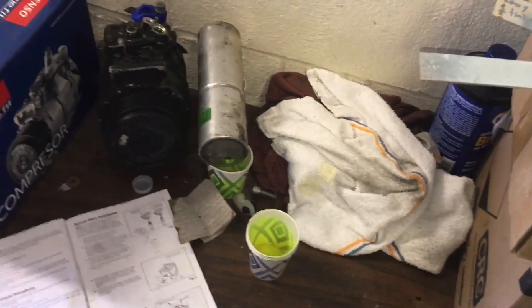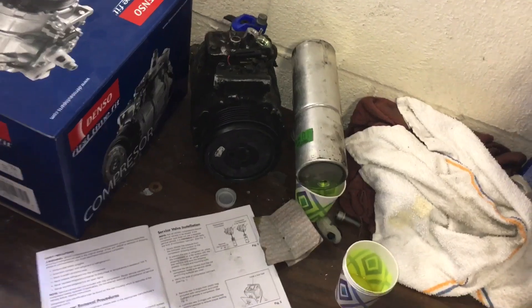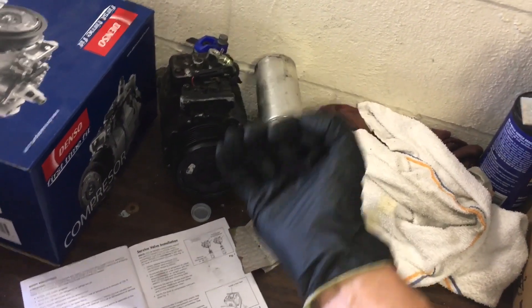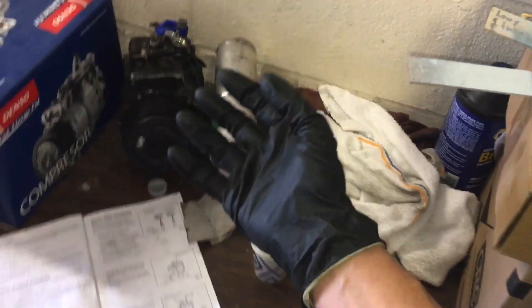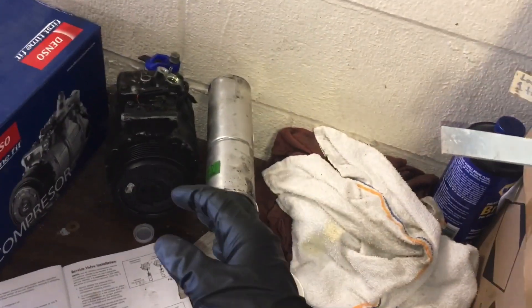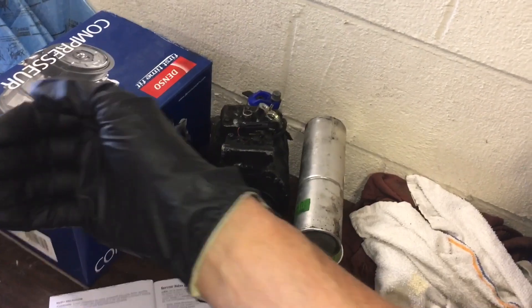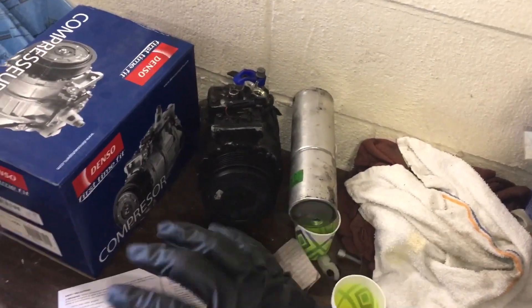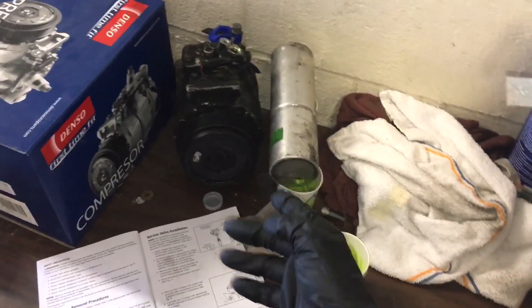A lot of guys don't change the receiver dryers, so you still have that oil in there too, on top of everything else — and they'd blow out shaft seals. In certain situations, you now have a ratio of oil to refrigerant that is too high, and oil is a very poor conductor of heat. More oil coats the fins inside the evaporator and does not want to let the heat from the cabin absorb into the refrigerant. It reduces your capacity, the customer complains of poor performance, and you can't believe how many parts get replaced trying to guess the problem — all because a technician put on a compressor filled with oil.